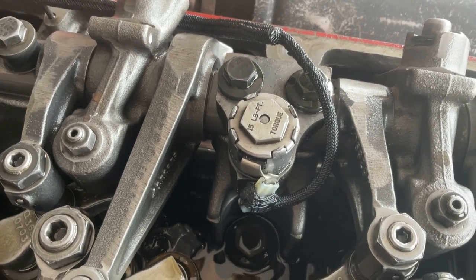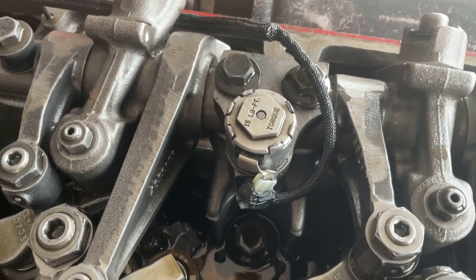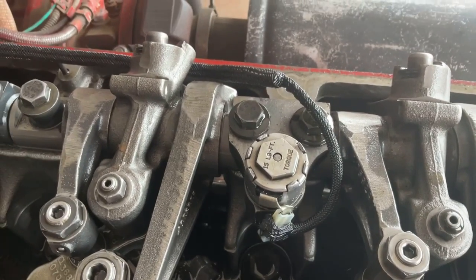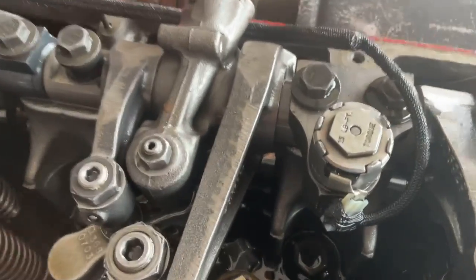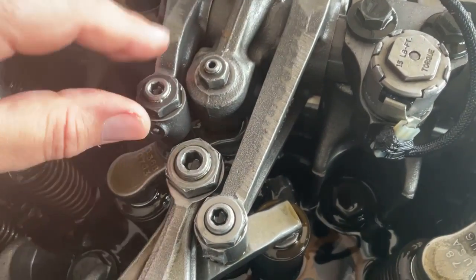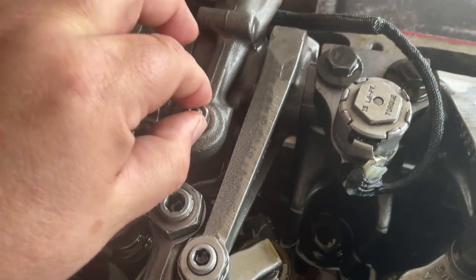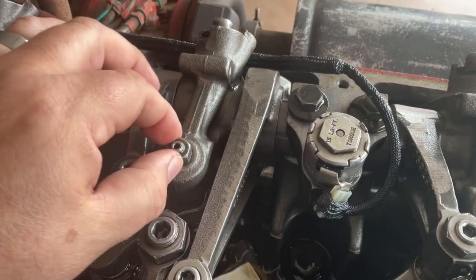But if you do push it and nothing works, even if you manually push the button, you could have another issue completely that's either hydraulically related or mechanically related. You could have an issue with the oil pressure required to offset the detents on these guys, or you could have a mechanical problem, which is usually the adjustment. If you look on here, you see adjustment screws. So these need tune-ups, just like any diesel, where you adjust valve lash, injector height, brake setting. They even make special tools you use to adjust the gap in there. So it could very well have been that someone misadjusted them or they are mechanically failing.